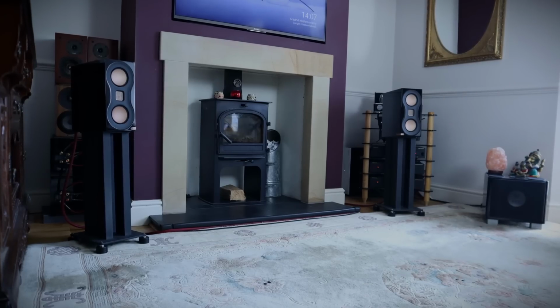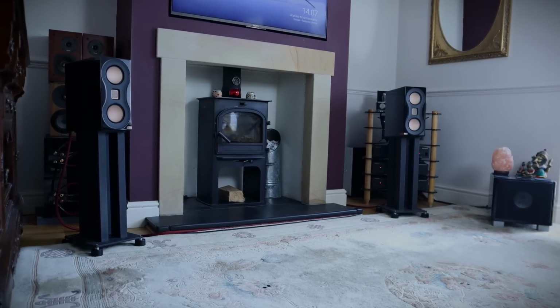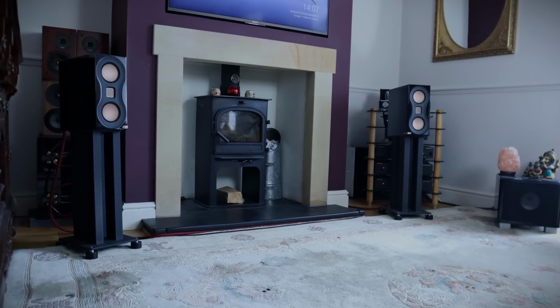I don't think it's placebo effect, but I did have in mind that the Studio 89s are most likely to sound best listening on axis. Being a D'Appolito design, they do favour on-axis performance over off-axis. Coincidentally, I did wind up with the tweeters pointing directly at my ears, both in terms of height and toe-in angle, but I didn't think they were more sensitive to this particular type of setup and positioning than traditional tweeter mid-woofer designs. What was more critical was how close the Studio 89s were to the walls behind them, but I suspect this has nothing to do with the MTM array, more to do with the interaction of the twin slotted ports and the boundaries around them.